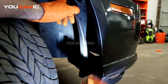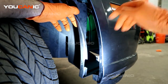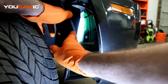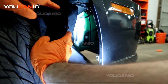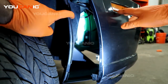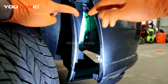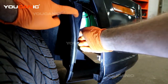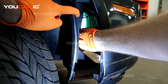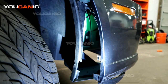There's one number 10 bolt right up in here that we would loosen and remove, and up here you'd reach your hand in or feel your way in. There is another bolt that you just need to loosen up a little bit so the bumper will fall down. You'll want to undo the electric that goes to this light, and we also want to disconnect the water line there for the window washer spray that comes out to clean your headlights.